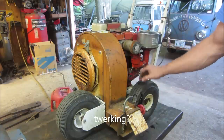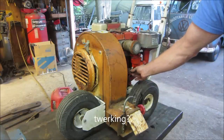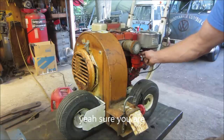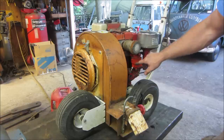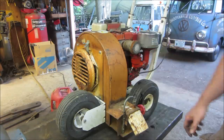I'm gonna choke it. Once I get the choke off, I'm gonna rev it up. I'm gonna run the main in until it starts bogging, then back it out and listen to it. Then I'm gonna bring it down to an idle, and listen to the idle speed and run that one in and out. And it may go back and forth. One does affect the other. The idle does affect the main a little bit, but we'll go back and forth and tweak them, find and get a good smooth spot, and then we'll be good with it.